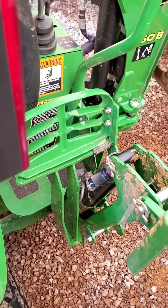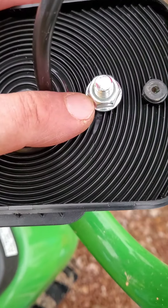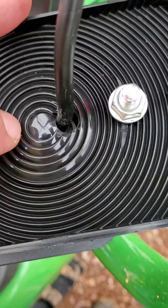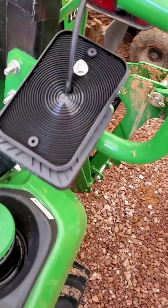Put those two little screws in there — wire it first, then put it in. I drilled two holes: one for the wire. I'm going to put some rubber grommet material in there to keep the water out. Mounted it with a simple bracket, real easy. Tighten it up pretty good. This material is pretty brittle, so be careful when you're drilling it — I almost cracked it by putting too much pressure. That's why I use the multi-bit; it's a little more gentle versus a regular drill bit.